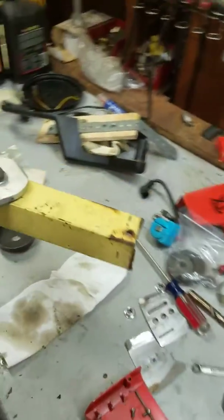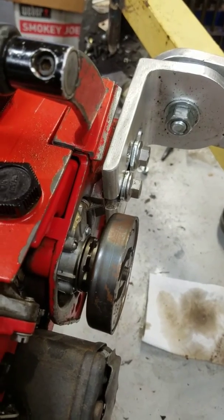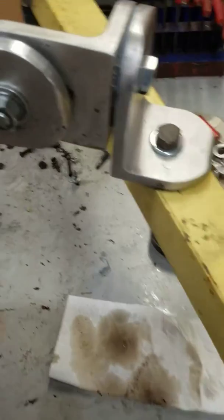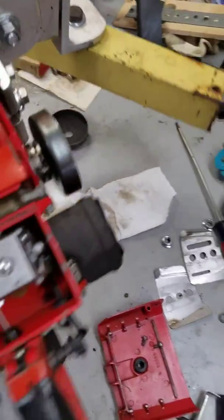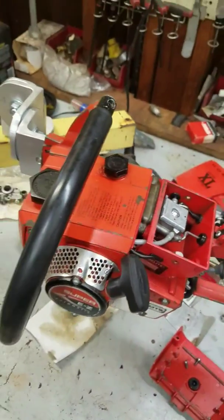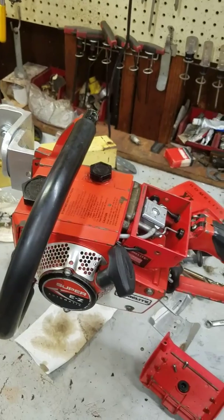Like I said, the crank seals have been done on this saw. We have the new rim clutch sprocket set up, which is a very nice feature. You can see it's been oiling quite well — I've sopped up plenty of oil on the test runs. Anyway Gary, I'm gonna let this sit a little bit, fire it one more time, get the fuel out, and we'll get it back to you.